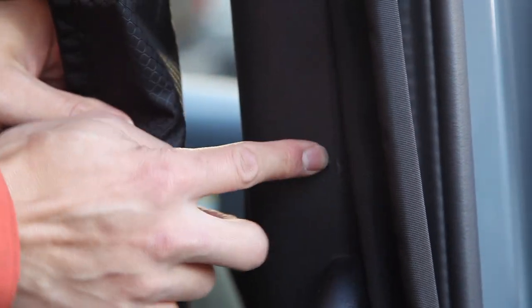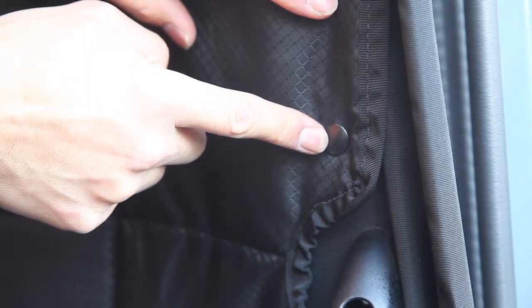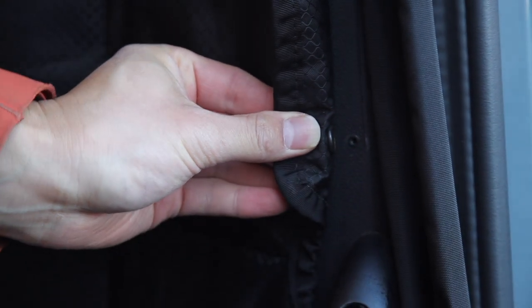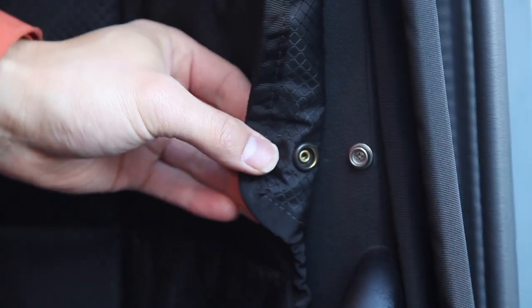With your partition centered, the next step is to install snap screws along the B-pillar. I already had some installed, so you'll see holes from that — just ignore those. Basically, every spot where there's a snap on the side of the partition, you need to gauge where the snap screw will end up. Take your Sharpie and mark that, then using your driver — you don't even need to pre-drill — just screw it in and you're good to go. Snap it on, and do that for all the snaps along the side. Installation is complete.